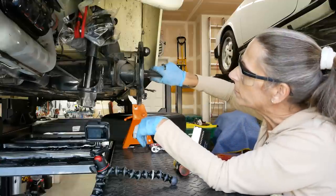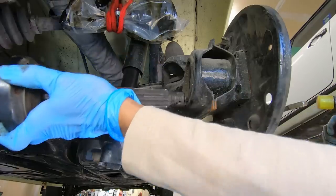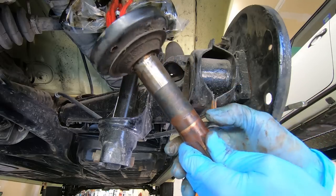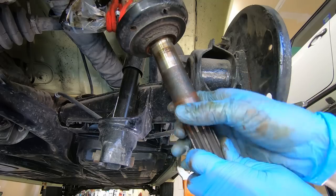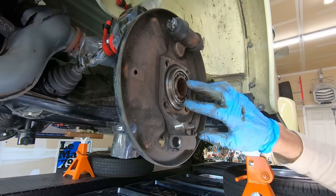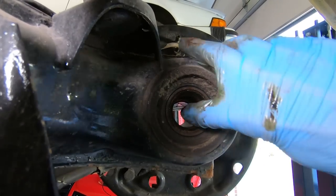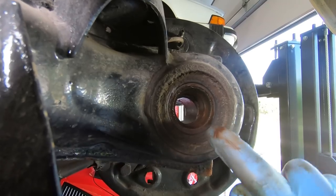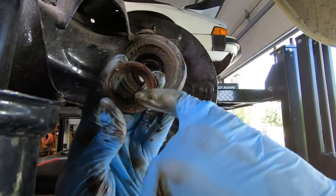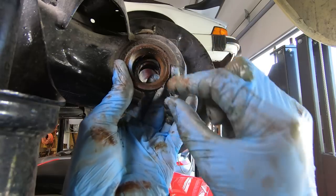With the front plate loose, we can just push the axle backwards. It just needs a little convincing. Take a look at the condition of our axle — it doesn't look too bad. It's a little dry; I would have expected a lot more grease in here. The rest of the axle looks like it's in decent shape. There's an inner and outer bearing race — the outer bearing race is roller bearings, and on the inside it's ball bearings. We also have that big spacer we need to get out, and our seal back here.